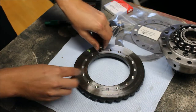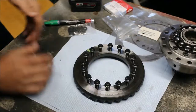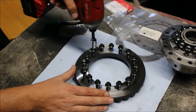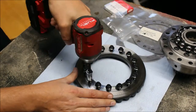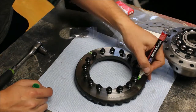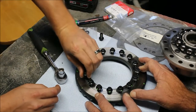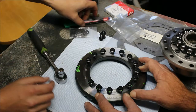I like to just go around and turn them all in first. We're also going to make sure there's no issues with the bolts — no bad threads on the bolts or the holes. You can use an impact gun at this point and just turn all these in until they get tight. Make sure you're not driving them in. Then go around and make a mark to mark where each one starts. Now we're going to count how many turns it takes to unscrew each one: one, two, three, four, five, six, seven, eight — I'll stay with just eight.